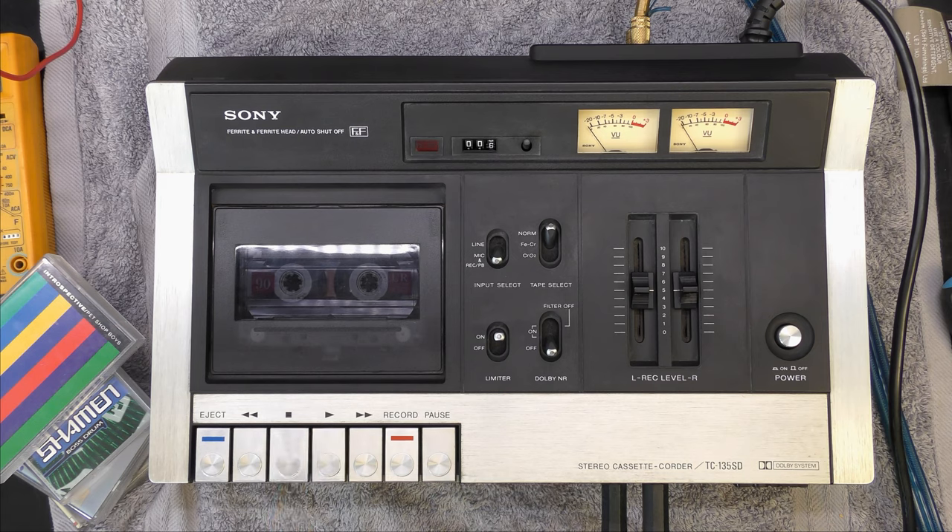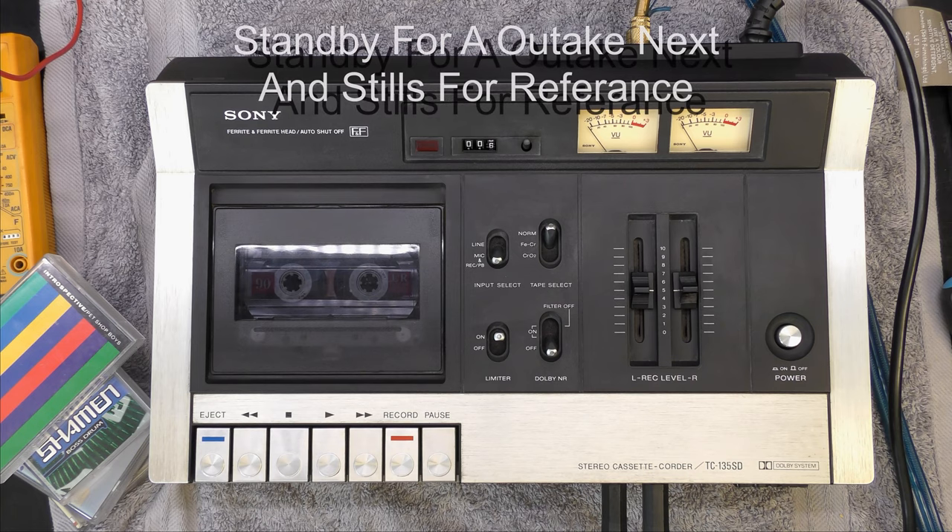It's a nice sounding deck — it sounds solid. I think having a tachometer on the motor actually helps to reduce wow and flutter. Very nice deck for the age of it. No capacitors were changed; as for the instability, I haven't seen any trace of it since. I've recleaned the contacts and removed that adhesive and it all seems very well now. The head hasn't got any wear on it because it's a ferrite head so it's going to be pretty tough. Anyway, I think that'll do for this one — thanks for watching, and I think there's about another 10 cassette decks to go through. Oh dear!